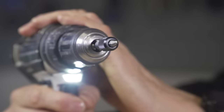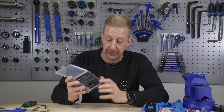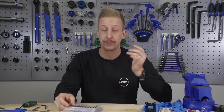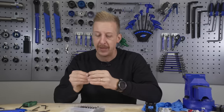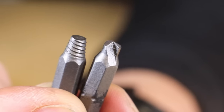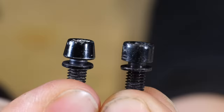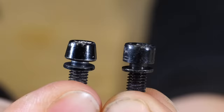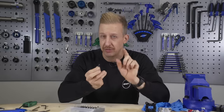The last option, which literally never fails but can take a bit of perseverance, is to drill it out. You're going to need a drill with quite good high torque power because you need to do this very slowly and precisely. You'll need some specific bits - I've got a little set here, actually fairly cheap from Amazon. If you're a pro mechanic, you'll probably have easy-outs or high-quality versions of these. The bits themselves are used in reverse to cut into the head of the bolt. You'd use the nearest size to the head of the bolt itself. Ones that are square in profile have more material - it always works with these - but sometimes you get tapered ones where you can actually break the head of the bolt off, so just be careful.